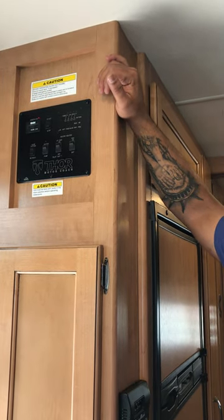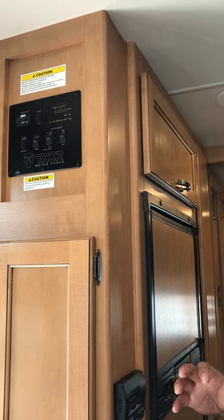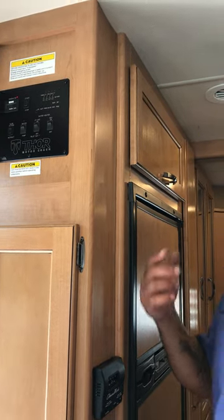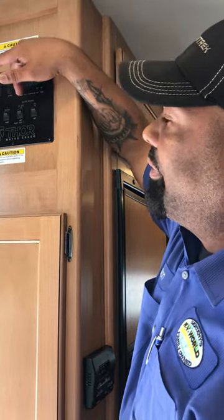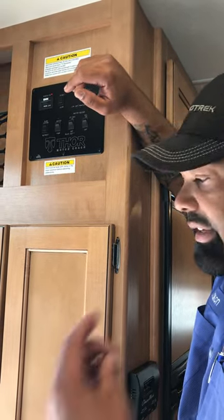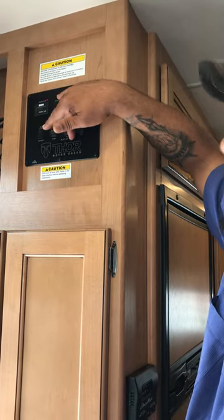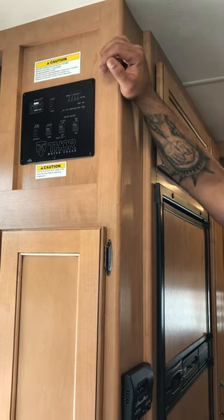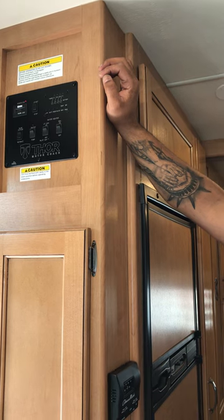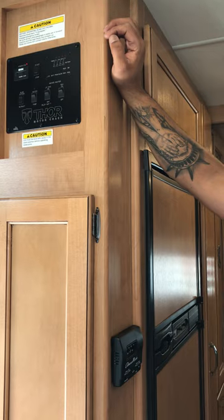Yep. Once the water reaches temperature, it'll cut off the burner tube outside, and once you've got cold water back in the tank, it'll heat the water back up and turn the burner tube on. You don't have to light anything, it does it all itself. Once you hit that button, it starts sparking and it lights as long as there's gas. If you see the pilot light out, it just means either you're out of propane or you have some kind of blockage that's not allowing gas through the valves.